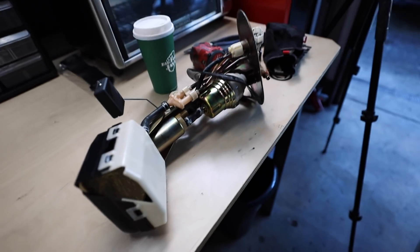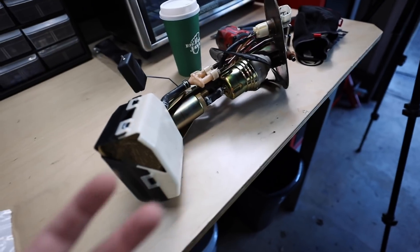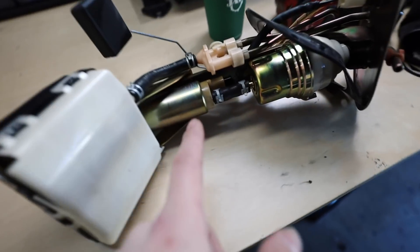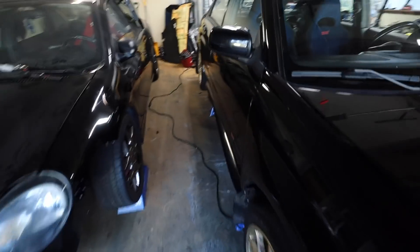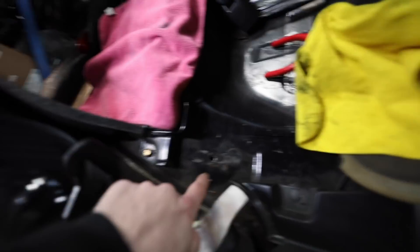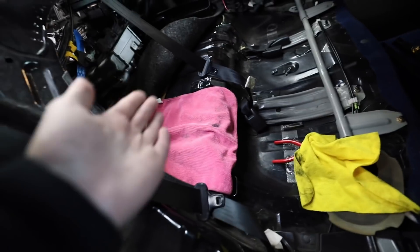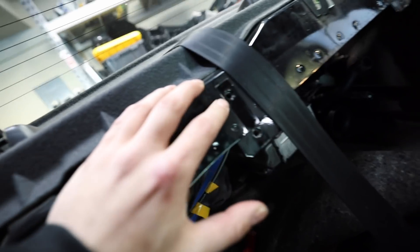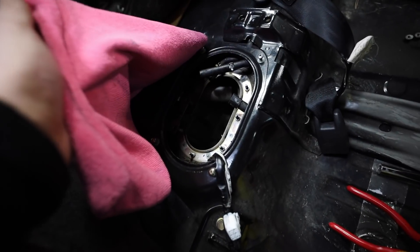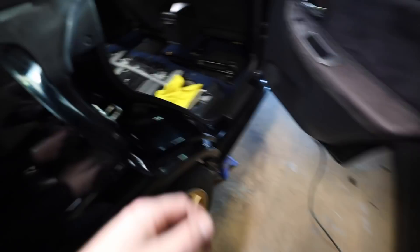Here's our fuel pump assembly — entirely different than a newer WRX or STI. It's not an actual fuel basket; it's literally a fuel pump assembly with a fuel filter sock down here. Fuel drives up, goes out, goes to the front of the car. Taking it out is a bit different than I remembered — it's not directly under the back seat, but you still need to pull the seat. You remove the lower cushion with two 12mm bolts, then the upper cushion with three bolts, then pull out the black cross bars, and then you have access to the fuel pump secured with standard 8mm bolts.